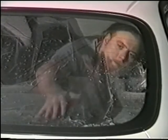As you unroll the film, you will notice that the film is sticking to the window and the liner is coming off of the back side of the roll. This is a complete reverse method of installing film, hence the back roll. Gently remove the liner from the film before beginning the squeegeeing process. Then position the film evenly so that the film is exactly where you want it.